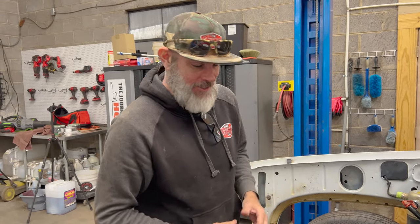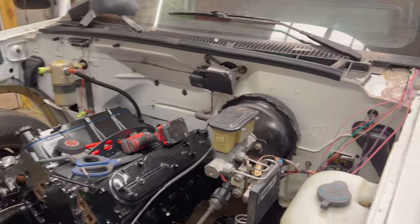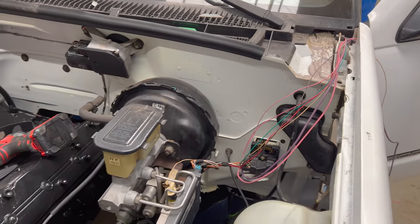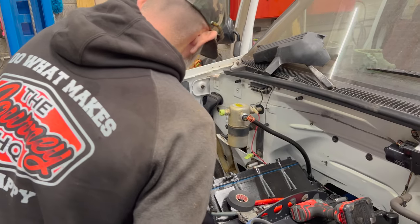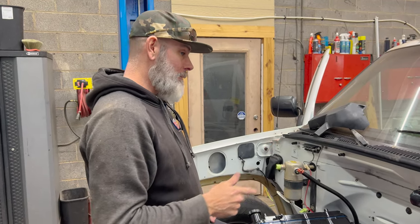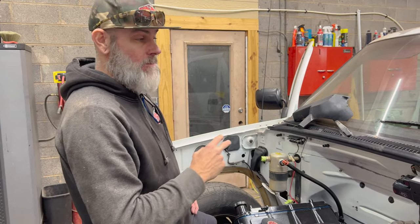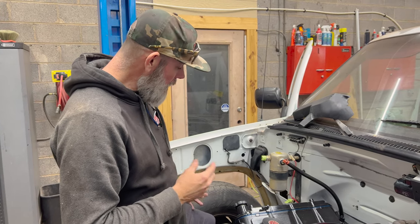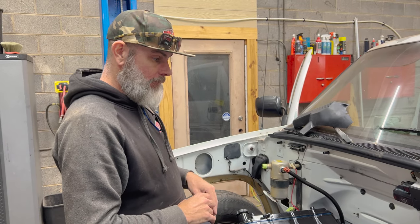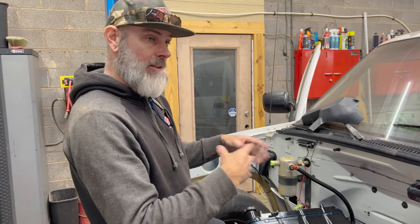I have magically transformed that pile of wires into about 10 wires under here. And then of these, only three of them matter. The rest of them are bonus wires that I can use for something else. So I am happy. The AC controls come on. The ignition comes on. When I hit the key, I get power to my starter wire. The radio comes on. The only thing that's not working is the wiper motor, and I think it's a bad switch on the column because somebody's been in there jacking with it. But maybe another 30 or 45 minutes and I'll have these done enough to carry on to the next step, because I don't want to put loom on them yet in case I got to add wires for the LS harness. I can add them in and then loom it all at one time.